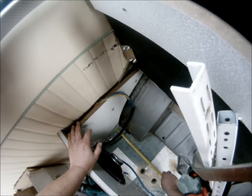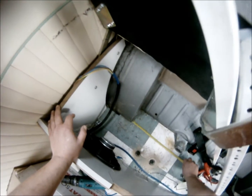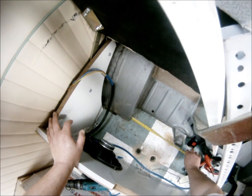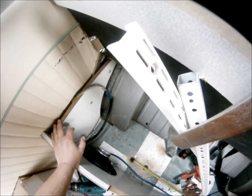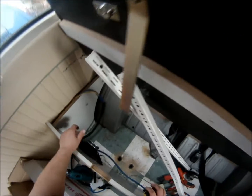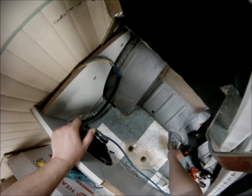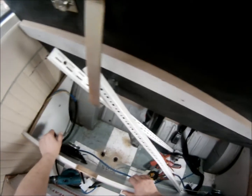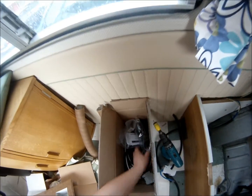you can't use that as a reference point because that could be anywhere on the bus. But from there to the first hole is 130 roughly. It's 130 from the edge of the wheel arch to there. You need to double check because you may have had welded in wheel arches and stuff like that, but this one looks pretty good. And I should clear that. We don't use that, but obviously on an early Westie and a cross dresser like this one, it is used, but Adrian's not using it.